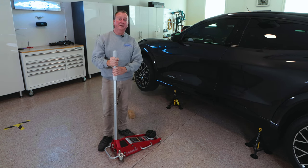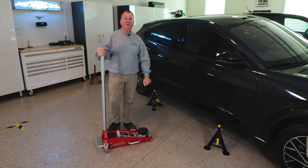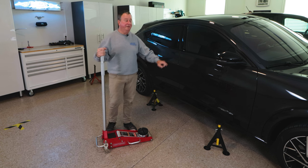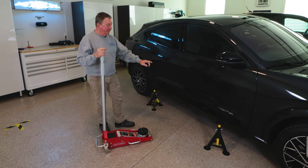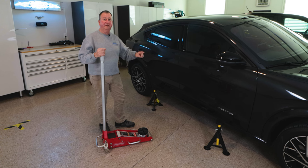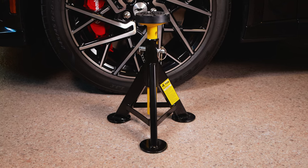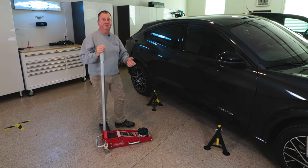So what we're going to do now is spin this around. Now that we've got the other side of the Mach-E jacked up — a little bit of TV trickery, which is easier than setting up the camera again. I do have the driver's side jacked up now. Things we want to watch out for as we're jacking is that the stands on the other side are not moving. The stands I'm using are extremely sturdy and have a good spread on the feet, covering a larger area so they're less likely to tip over. Depending on the stands you're using, this could be an issue. If you're on gravel or even grass, you're going to need to put something underneath the jack stands as well as the jack so it rolls properly.